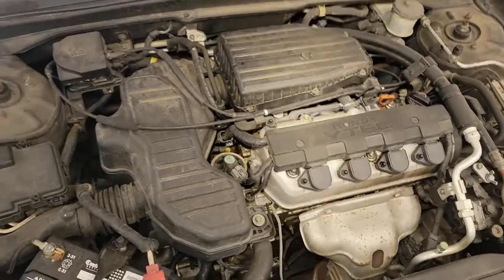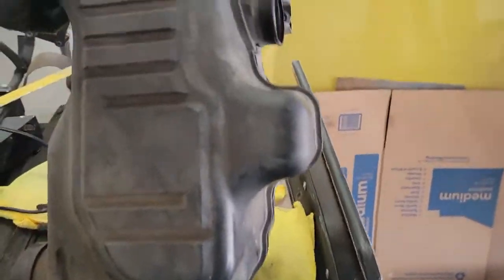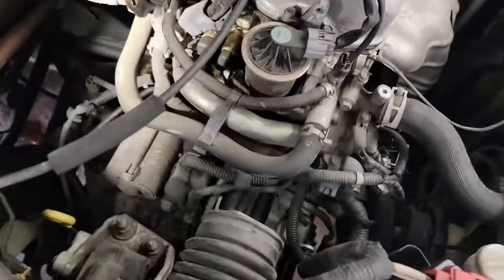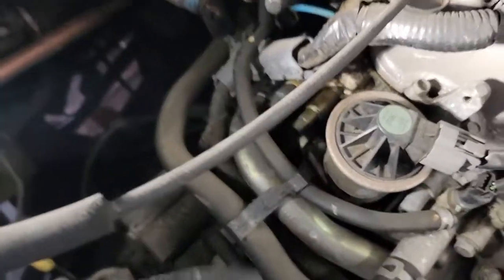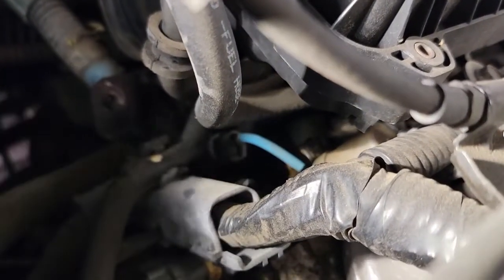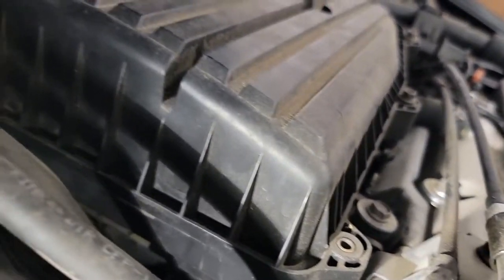Let me get the air cleaner off - I don't think I can do these checks with it in the way. I'm down to the valve now. I just took this part of the air box off. I started to take the entire assembly out, but that 10-millimeter bolt there and a couple other hoses may have had to come off, so I didn't have to take the whole thing out. What we've got to get to right now is this connector here for the pressure switch and that connector right back there for the solenoid. I need to unplug that and make sure I have continuity through the solenoid. I think the spec was 13 to 40 ohms - that's probably a tolerance for temperature. The engine is fairly cool; I just pulled it inside.